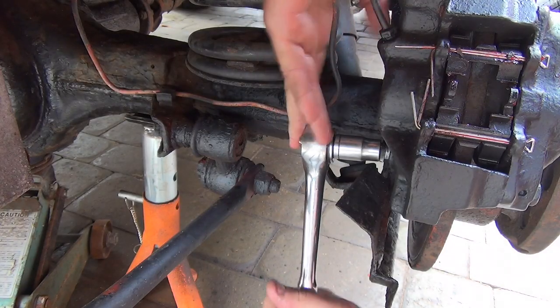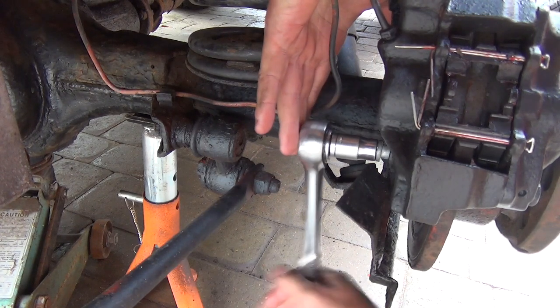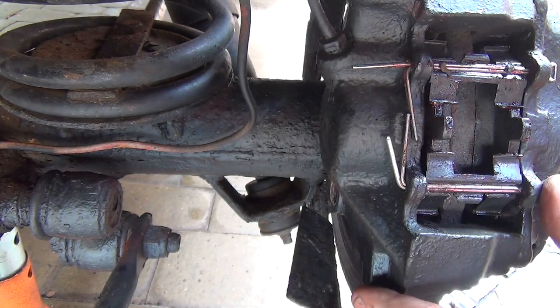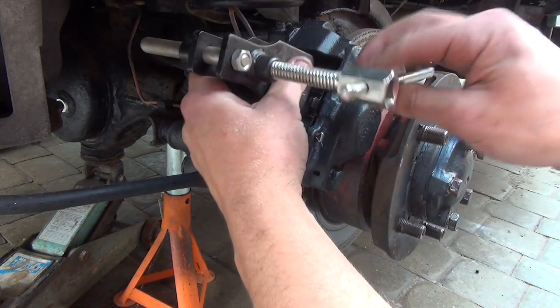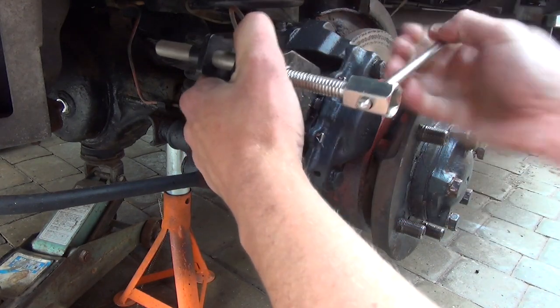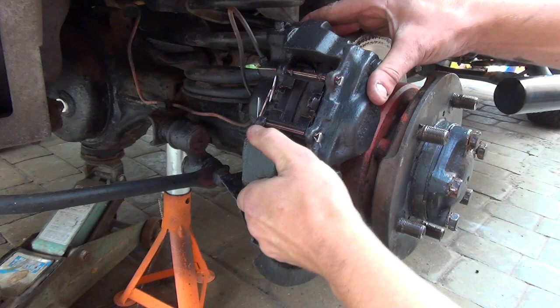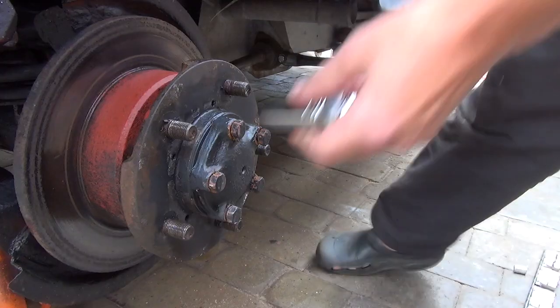These components take a lot of wear and tear and are badly corroded. They are quite tight because they are loctited in securely — these are brand new, only been in a day, and out they come. With new brake pads fitted, I'm using a tool to push the brake pads back so it's easier to remove and refit the caliper. Slide it up and tie it securely out of the way, making sure you do not bend those copper pipes.